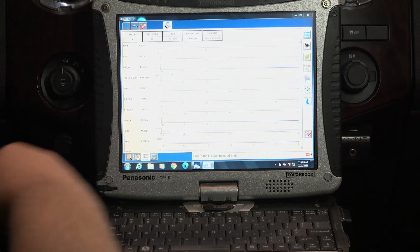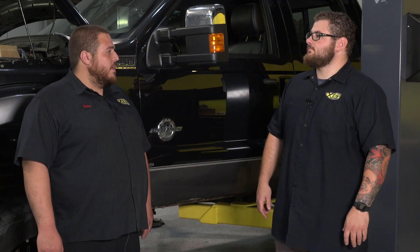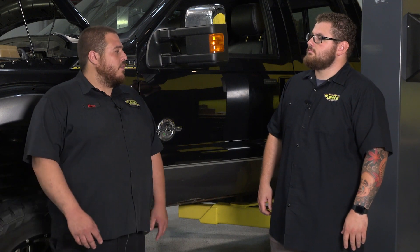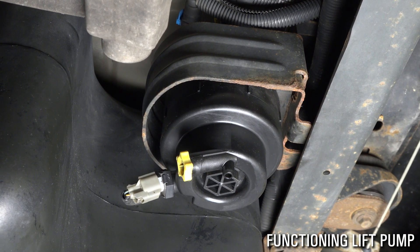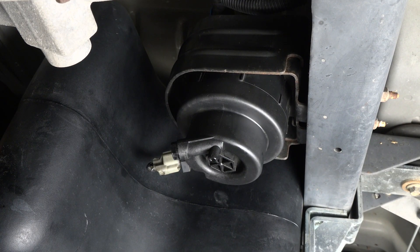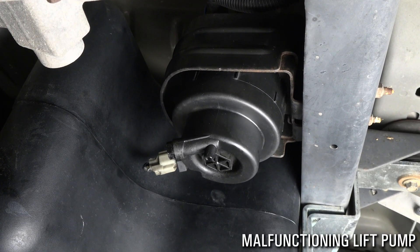Now that we're already set up with this, you can actually command the lift pump and go outside and actually hear it. If your truck isn't running, you might want to take a look at your lift pump. On this truck we actually know the lift pump is functioning correctly. I want to show you what a healthy pump sounds like versus a pump we have in the shop right now that sounds like it's pulling air. You could hear the lift pump run smooth with no hiccups or abnormal noises. In this case the pump is a little noisier and not as smooth, which isn't a no-start condition, but it could definitely contribute to CP4 failures. With no-start conditions you will have one or two things — either an extremely loud lift pump or no sound at all. Extremely loud lift pumps are most likely caused by a clogged metering valve due to metal shavings from the CP4 pump, and we'll show you the steps along the way to check that.